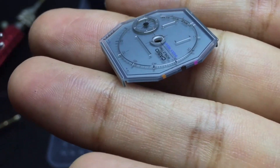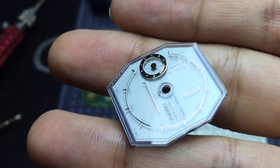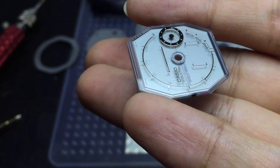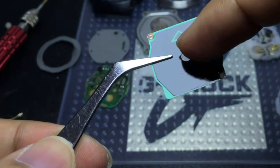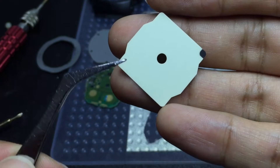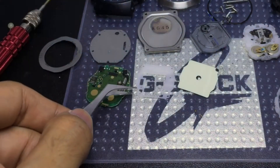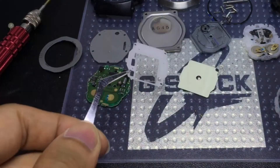The back part goes pretty basic. By the way, this is the connector — they literally put all those on the polarizer sheets. So technically you cannot customize this to a negative display version if you wanted to, or any color way at all without affecting this silver piece on top. And this is the EL backlighting sheet from the back — this arrow is pointing to put this upwards. So basically everything lights up but is somehow filtered by this part, giving certain areas brightness over others.